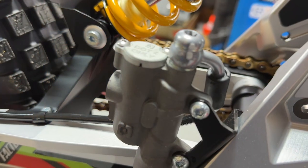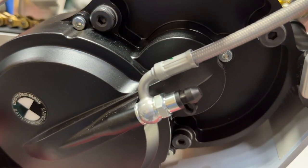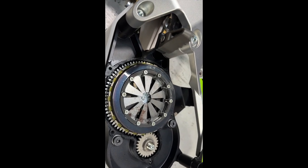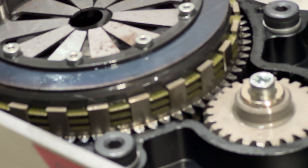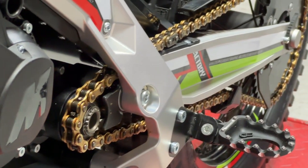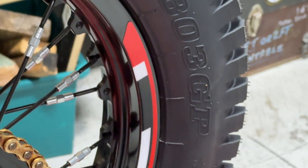The Brake Tech rear master cylinder is the same as used on a Gas Gas Racing, GP, and Beta Evo. The clutch case is very similar to Gas Gas in its layout; with the cover off you can see the thrust bearing and bush, and the clutch itself is the same style of diaphragm clutch found on Gas Gas, TRS, Vertigo, Electric Motion, and now Sherco — five plates, three frictions, two steels. The rear brake pedal has a nice eccentric adjuster for lever position. S3 Hard Rock pegs, typical Iris gold chain, Gas Gas-style front sprocket with the same spline size so many sizes are available. Dunlop 803 GP tyres and lightweight Morad rims with cutouts — tubeless rear rim, Galfer 150mm FIM-style rear brake disc.